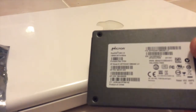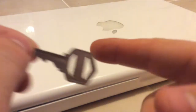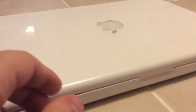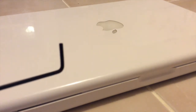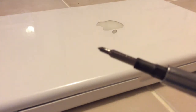I think this is as good as you can get it. You can see how it has HP on it, but it was made for HP. We're also going to need a coin — I don't have a coin so I'm just going to use the head of this key — a T8 Torx bit. I don't have a T8 on hand, so I'm using a 5/64 Allen key wrench. And you need a number zero Phillips tip.